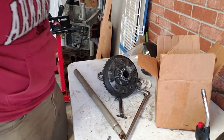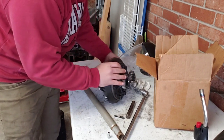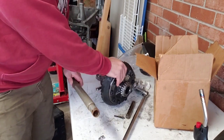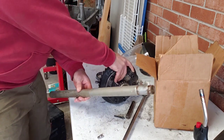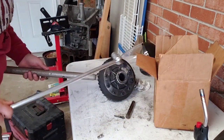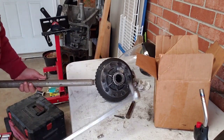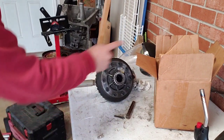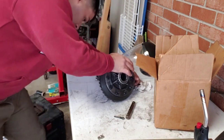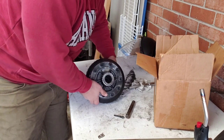All right, that was rough. I ended up pulling the pin out, sticking my ratchet through. It's a 1/2-inch drive ratchet. Taking the pipe from my jack, putting it on this side of the ratchet, and then taking a breaker bar and breaking all these loose. I'm not 100% sure what these things are torqued to. I will look whenever I put it on the other gear. And I was told whenever I bought the car, the rear had a, oh look, now I can't get it out. There we go. I was told whenever I bought the car, it had a 410 gear in it.